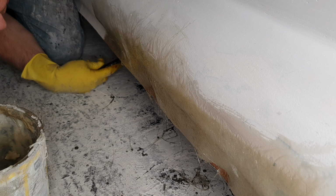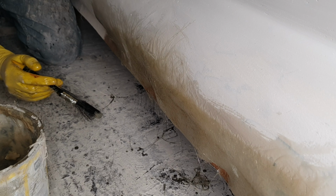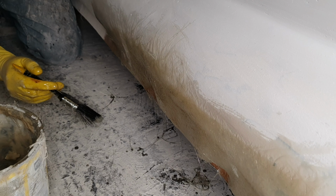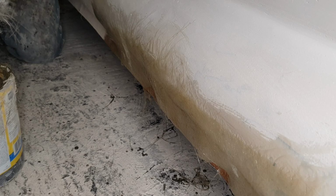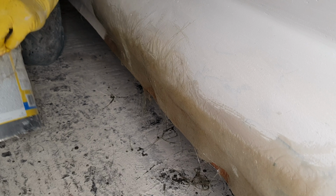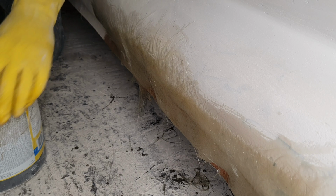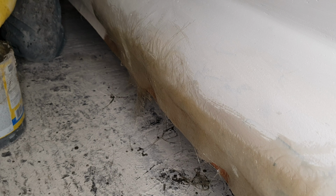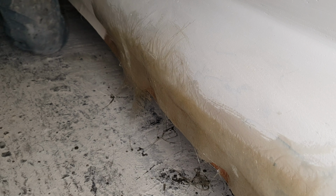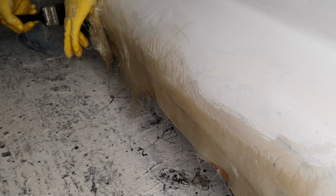Okay, not bad. So you can see the shape come along nicely outside there now. Obviously we'll need filler work and everything else on top of this, and probably another layer of fiberglass at some point too. That doesn't matter. As I say, if you put too much on all in one hit, it'll be a nightmare. You really don't want that. It's a bit of a fine art, this thing. Everyone does it differently, to be fair. Some people do it like this, some people do it in moulds or all sorts of ways. Some people paste it on the car afterwards. I tend to just paste the actual stuff.